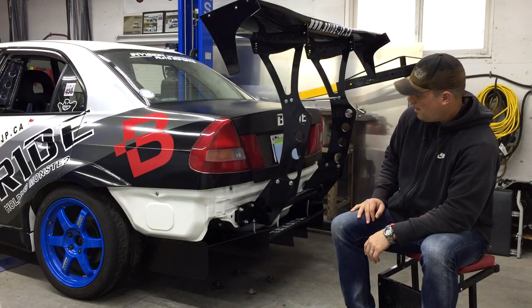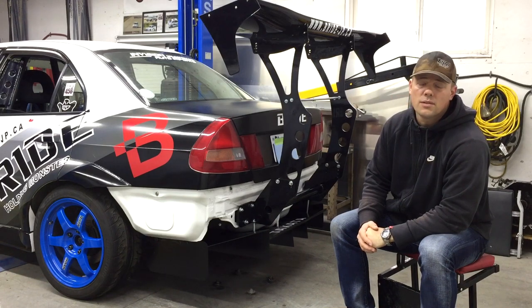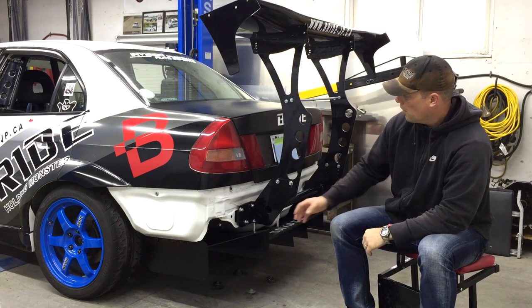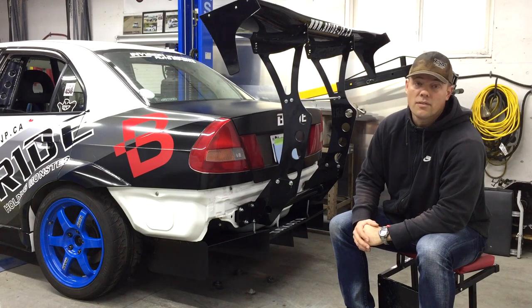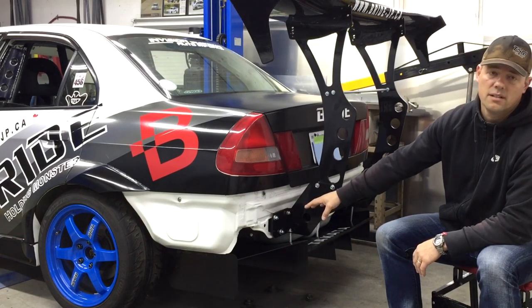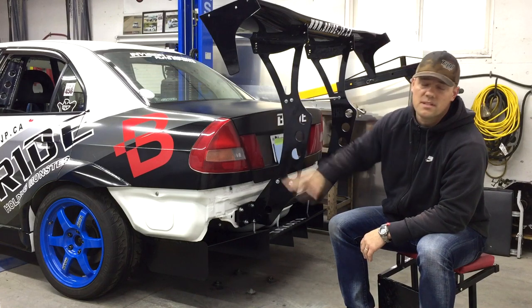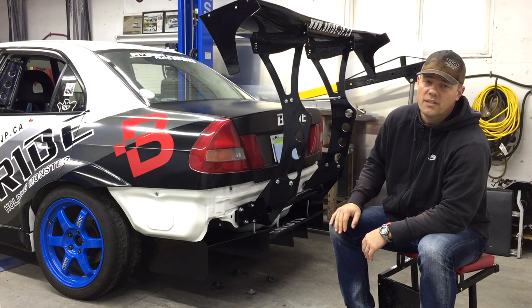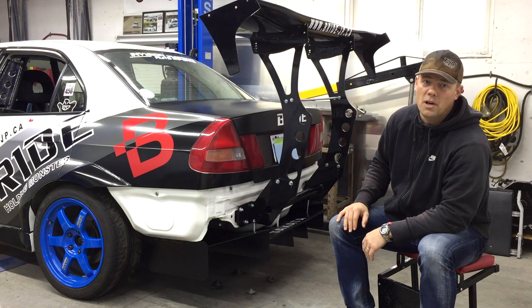Next on the back of the car we opted to do a diffuser across the bottom. The diffuser is mounted to custom mounts — one directly in front of the differential and two more mounted where the spoiler integrates into the stubs for the rebar for the rear bumper. The idea is that any downforce created by this aero is going to be exerted onto the frame of the car. We had problems in past seasons with the trunk deforming while running a fairly large GT wing, so we moved to this style of mount to save body panels and allow all the force to go into the frame rather than distorting panels through flex.